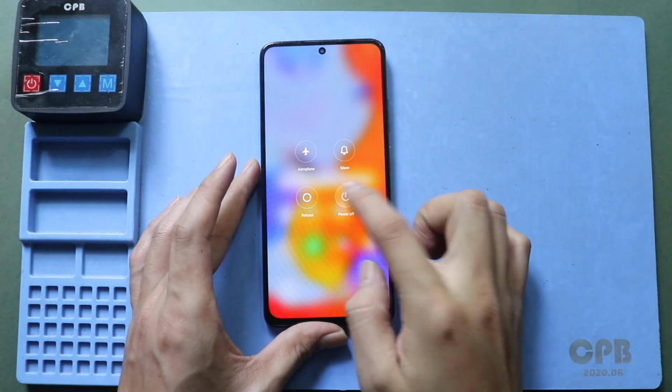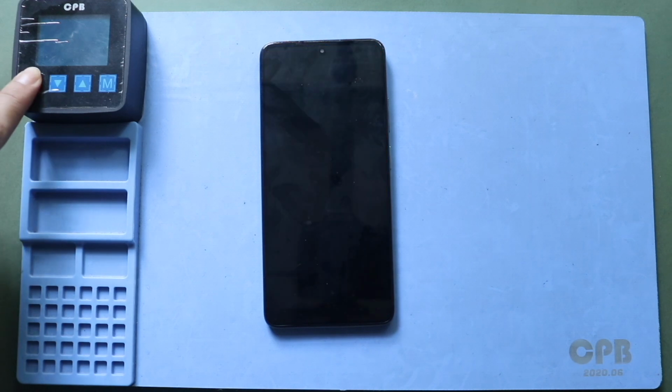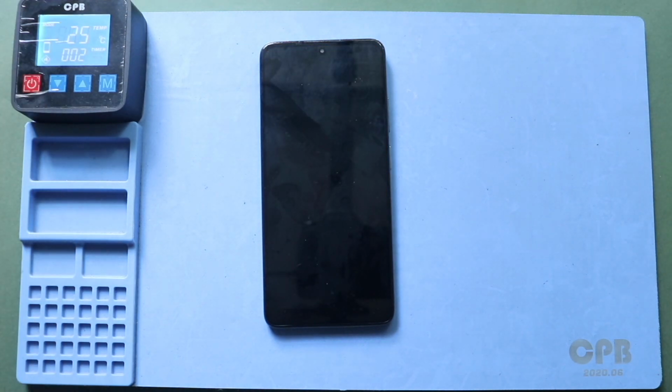Today we will show you how to replace the LCD connector flex on the Xiaomi Redmi Note 11 Pro mobile phone. To start, we need the right tools to proceed with the repair, which are listed in the description. First, turn off the phone and eject the SIM tray, and then follow the back cover removal process.